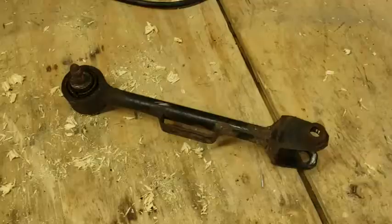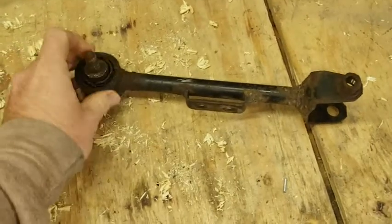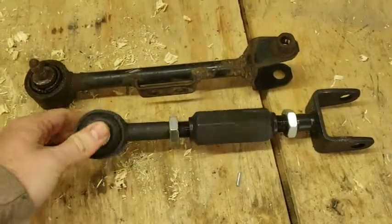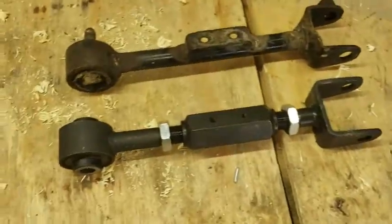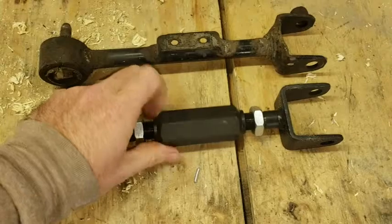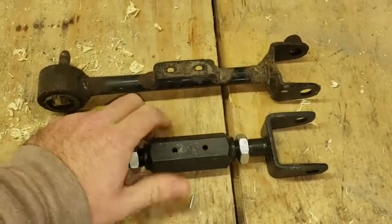Because these tires are new. What happens is the rear upper control arm — this piece — wears out and there's a lot of play in the system and it kind of pushes out. You can replace it. I found these really cheap — I think a set was 50 bucks — and this seems like a very good buy. It's obviously built to a much higher standard, and using this turnbuckle here almost turns it into a tie rod.